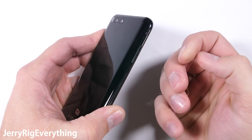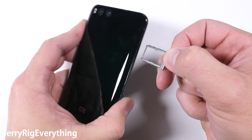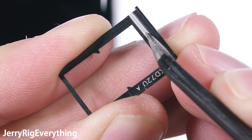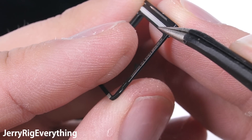As I mentioned in my previous video, there is an unfortunate lack of holes in this phone. There is no headphone jack. This makes the phone easier for Xiaomi to waterproof though, since water can't get inside a hole if it doesn't exist. The dual SIM card tray does exist though, and it has a very thin bead of rubber surrounding the opening. This is pretty similar to how Apple and Samsung have waterproofed their phones as well.